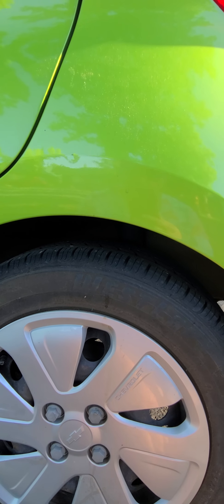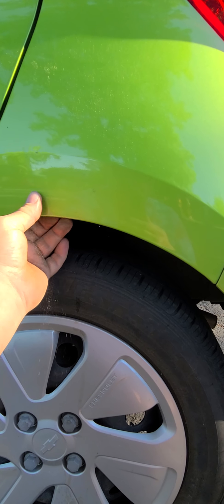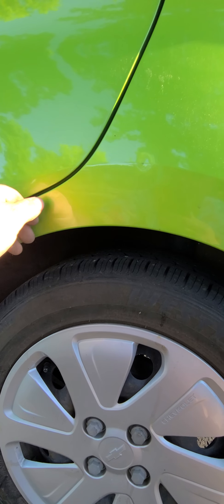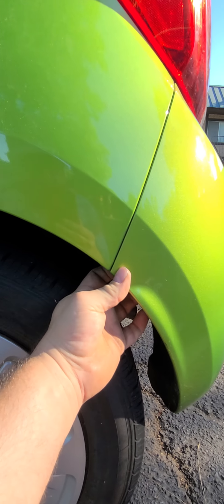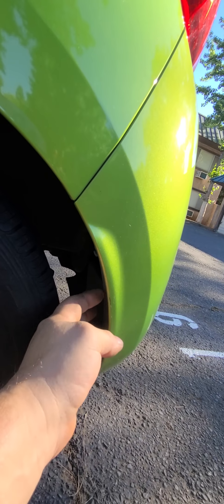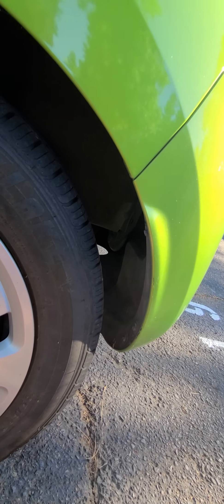Then you're going to drill holes, marking the spots with a Sharpie for the fender flare. After you drill the holes, you're going to use a pop rivet and rivet it to the car. When you do this, pay attention to what's behind — you want to be able to get your pop rivet in there without hitting something in the back, but if you do it's just plastic and it's not hard to get out of the way.